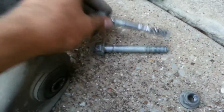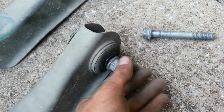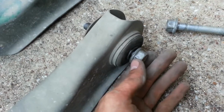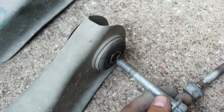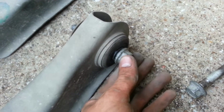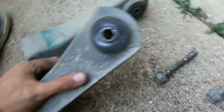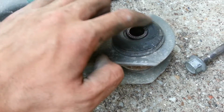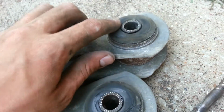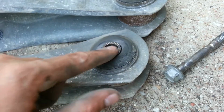And the bolt must have been spinning on it or rubbing up against it or something, because this bolt, let me see if I can find it where it used to sit, right there. It just moves all around and back and forth, and not good. I mean, one of the regular bolts still has a little bit of movement, but it's not anywhere near as bad as this. So that's what was causing the back axle to wobble around like that whenever I came to a stop. And you can even see where it was moving, because it rubbed right there in the little bushing, and this doesn't have any rub marks. This is from the driver's side, this is from the passenger side. Passenger side was where I was having issues.